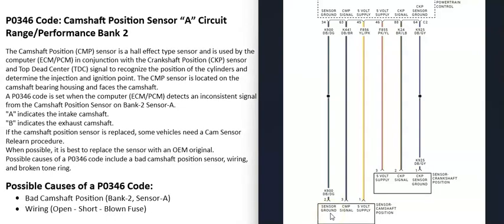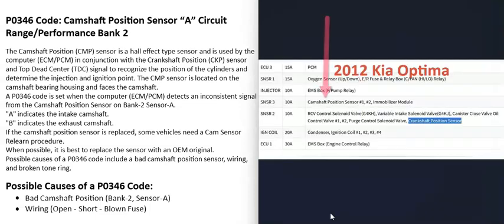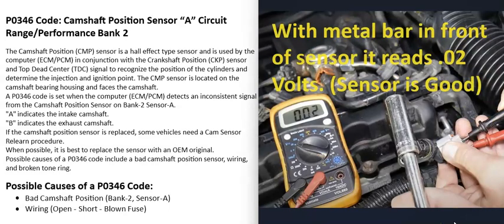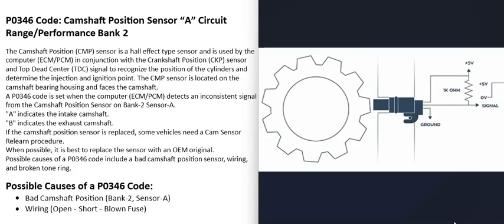With a multimeter, you can check that circuit — make sure you have voltage going to it, a good ground, and a good signal wire going back to the computer. It's also a good idea to check for any blown fuses, especially if you're not getting voltage to that circuit. One method people use is to remove the sensor, back-probe into the wires, put the key in the on position, and verify you're reading roughly five volts. Then place a piece of metal directly in front of the sensor — the voltage should drop. There are videos on this testing method linked in the description.